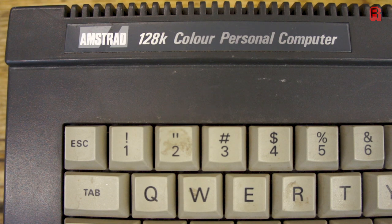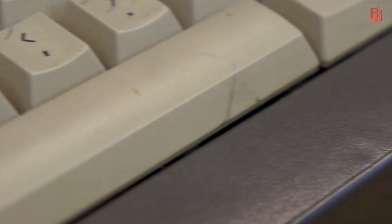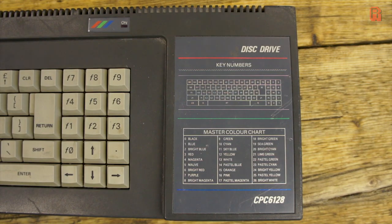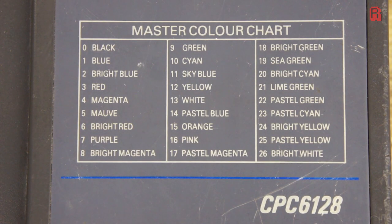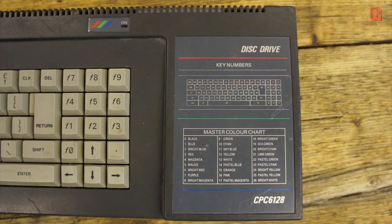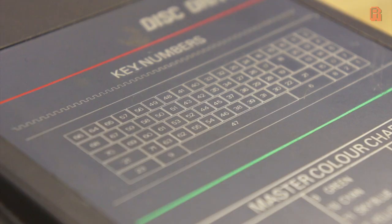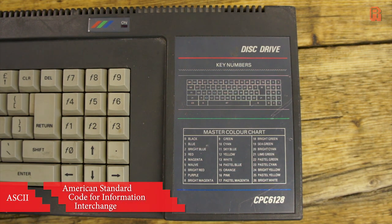It's a distinctly monochrome aesthetic compared to the 464's colourful keys, and this example shows all the signs of 30 years of neglect — dirt, pen marks, dust, scuffs and scrapes. A couple of charts spoil an otherwise useful coffee cup shelf on the disc drive, giving the colour chart and key numbers for the CPC. The palette of 27 colours was high for 8-bit micros: red, green and blue have three levels, giving 3 to the power of 3 combinations, or 27 colours. 16 can be displayed simultaneously in low-resolution mode, 4 in medium, and 2 in high. The key numbers reference indicates the number assigned to each key, and further numbers are assigned to joystick inputs, although for more in-depth coding you'll likely use standard ASCII character codes.